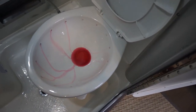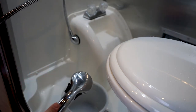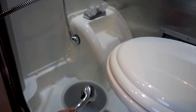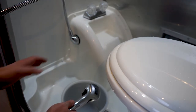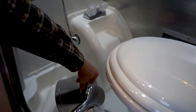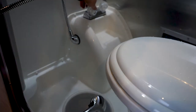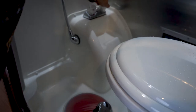Just double check your water line and make sure you're not getting too kinked up — if you invest in a slightly stronger hose you really won't have this issue. Now you can see pink is flowing out nicely. Go into the bathroom, flush the toilet — you can see pink already. Just make sure that a little bit of the antifreeze stays in the toilet. Next, do the shower faucet. Place a bucket in the bottom of the shower floor. Airstream recommends you remove all antifreeze from any fixtures or surfaces, so this way you can empty the antifreeze into the bucket and then empty the bucket into the drain hole to fill the P-trap. Turn one side on — got pink — and the other side on — pink.